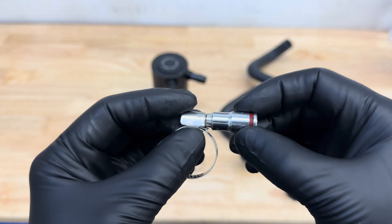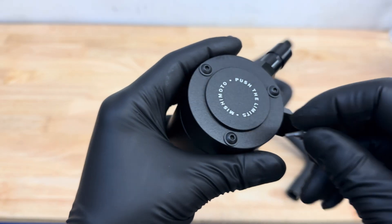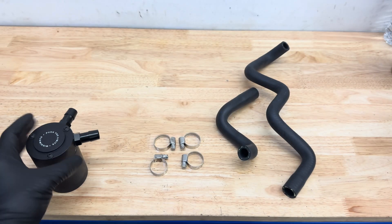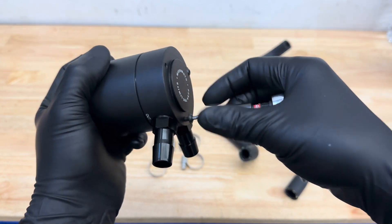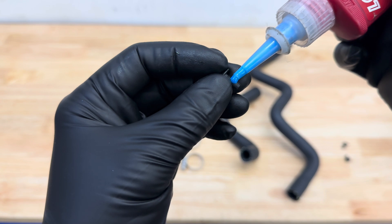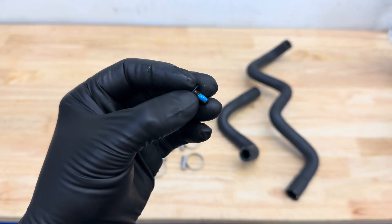You're going to need a 7 millimeter for the hose clamps, and a 2.5 millimeter hex for the top three little screws on the catch can itself. We're going to go ahead and remove the top three screws — they should come out without very much resistance at all. Because they do hold the can in place, I'm going to go ahead and place Loctite on all three of them, getting them prepped.